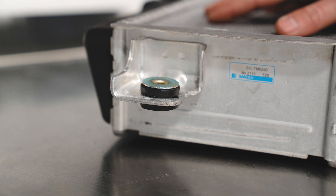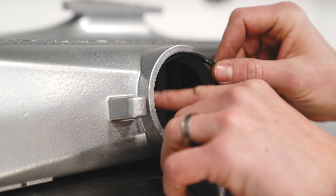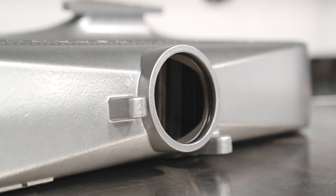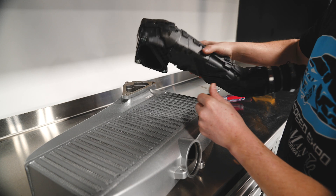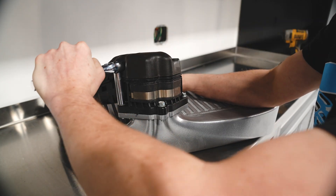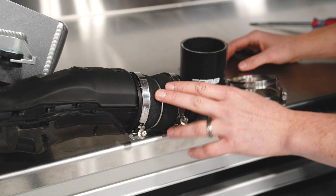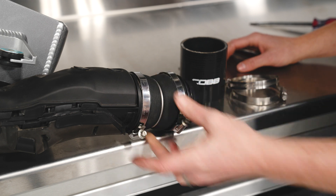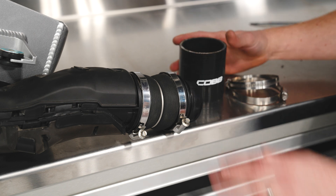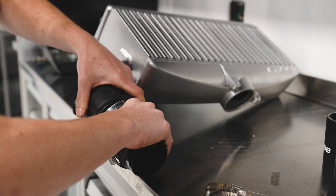The last things to transfer over are the rubber grommets — there's one on each side. Make sure your gasket is clean with no dirt or debris, and then install the charge pipe to your new top mount. One thing I've never liked about the stock top mount is the way the coupler is pinched with this metal band, so I'm glad that Cobb provides a new silicone coupler. Make sure the top hose clamp is loosened and then wiggle it off.